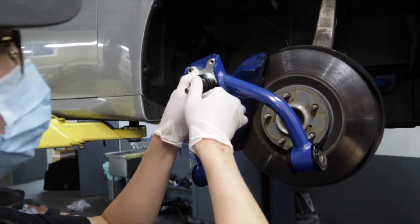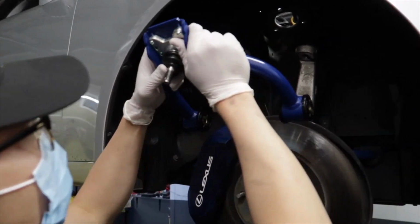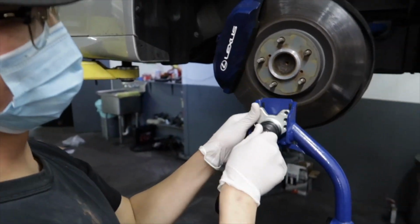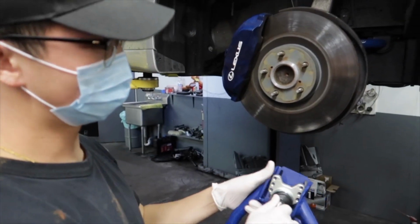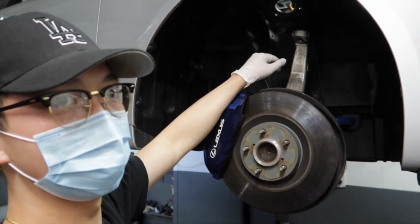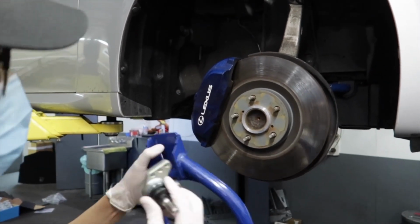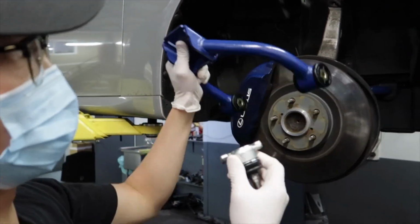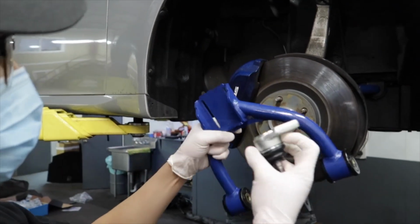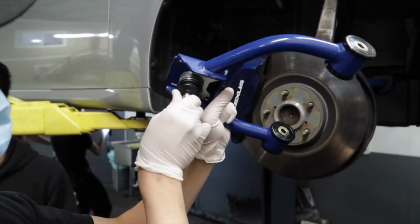Right here. So today we're here with two photos, the legendary dance god himself, showing us how to do work. So what you want to do is basically flip the ball joint. You want to push the knuckle in as much as you can, and that's gonna give you more camber. Alright, so the stock one, or a stock Megan arm, this is the wrong side, but I'm gonna just show you. So originally it's like this. This is stock.